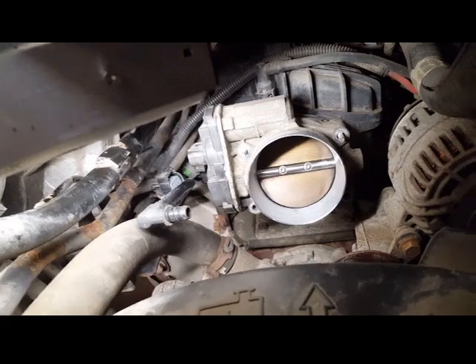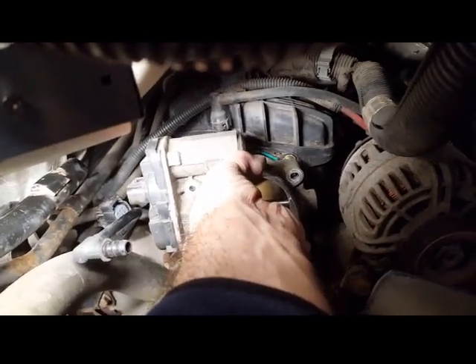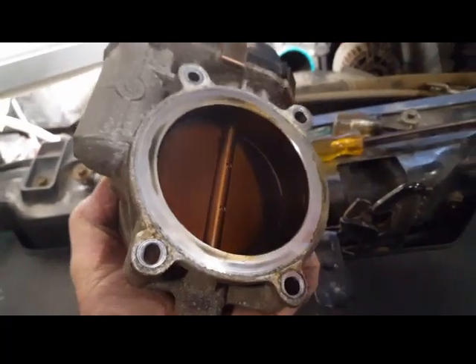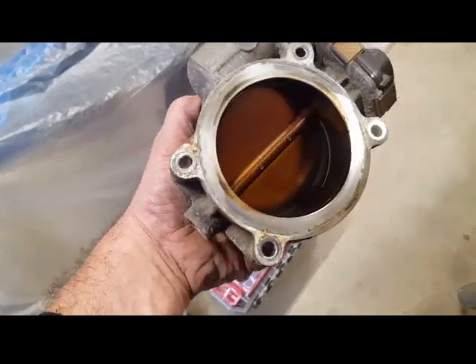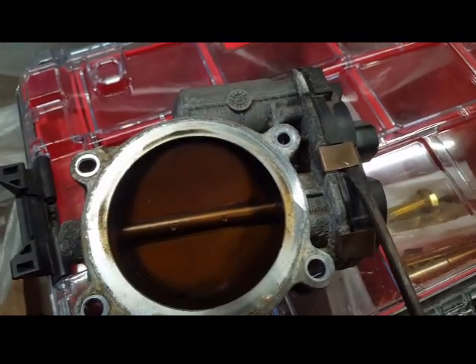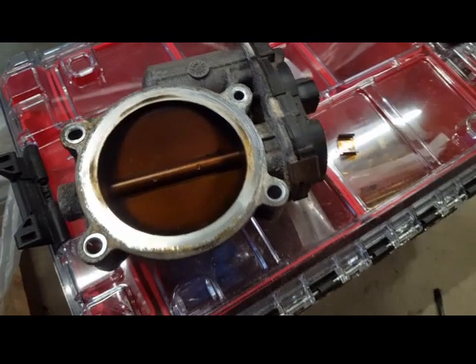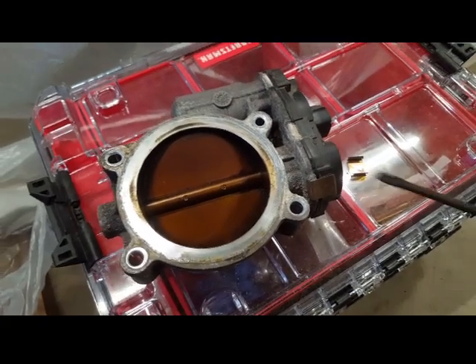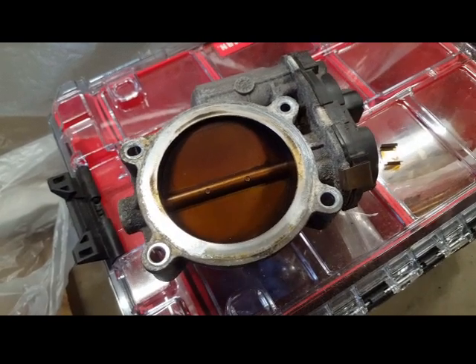What I ended up doing was taking the four bolts that hold the whole throttle body housing off. So this is the throttle body right here. Now I'll pull these clips off. Without taking the throttle body off on this particular GMC Savannah, you're not going to be able to get back there to remove these clips. So I suggest taking the four bolts out — that way you can remove it. Just stick your screwdriver in there and pry gently — there it goes flying. Let me finish removing the last clip and I'll show you how it comes apart.